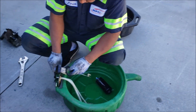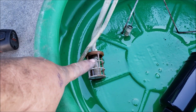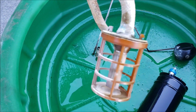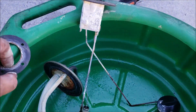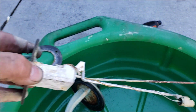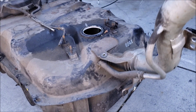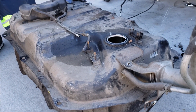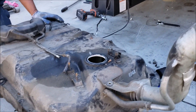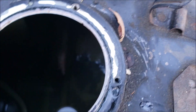All right guys, I think we found a good portion of the problem here. Our factory strainer is no more — it's destroyed, so it's not helping any. You can see all the little sediment already getting on my hand, so yeah, it's not good at all. Definitely corrosion, sediment, and some moisture. It's also in our fuel pump strainer. We got a new fuel pump, so we're going to take this to get hot-tanked out. Hopefully they're still open. The tank looks like a little beach in there — pretty nasty stuff.